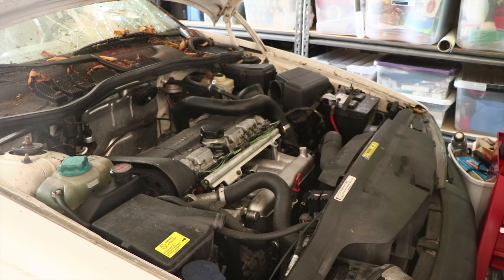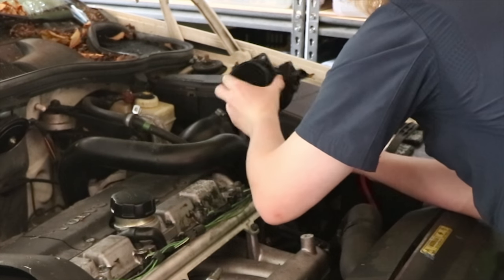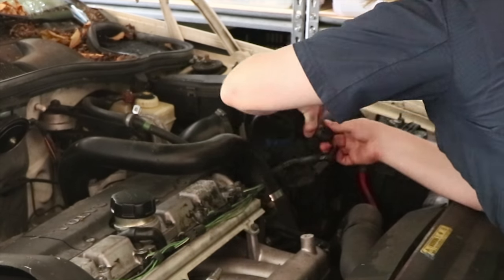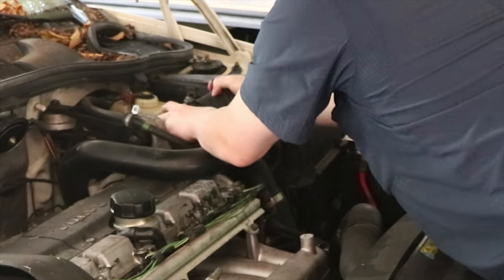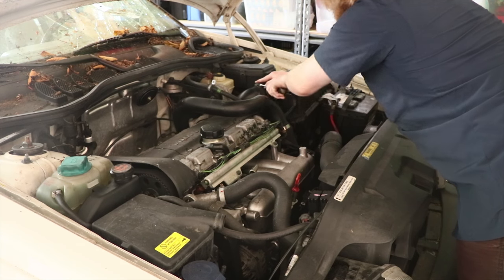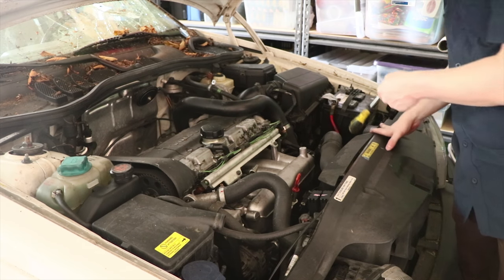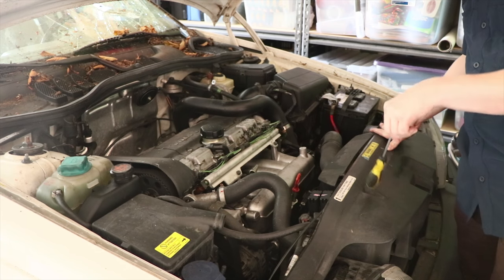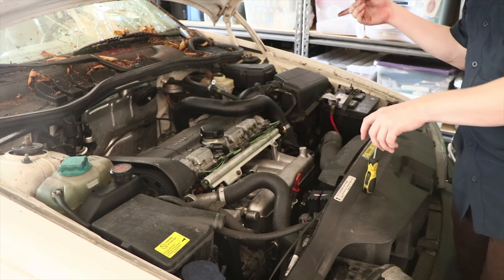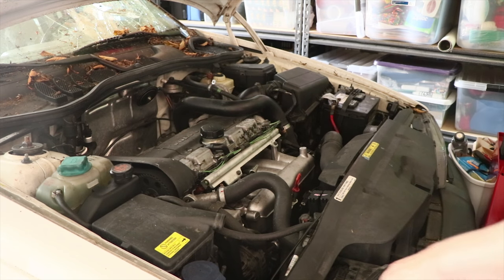These are super easy to put on and take off — all you need is a flathead screwdriver. Bad MAFs seem to be the biggest issue with poorly idling Volvos from this generation, but this one straight up didn't have a MAF. The previous owner seemed to have started parting it out before I bought it — it has no cat on it either, he just sold that, and I think he sold the MAF as well.